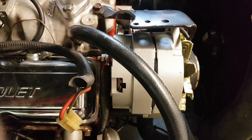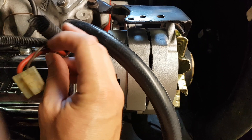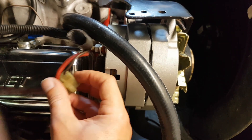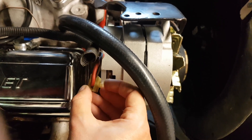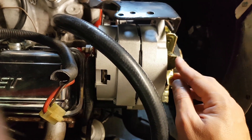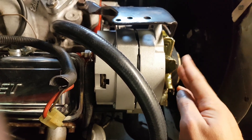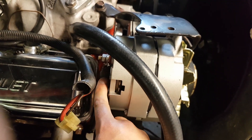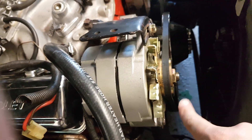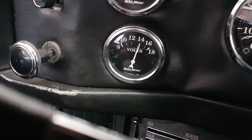There's our new-old voltage regulator. We'll put this in the car and see if it makes any difference. The alternator is back in — this is the PowerMaster one with the voltage regulator swapped over. I'm leaving the connector unplugged because it has the exciter wire and the voltage sensor on it. I think there could have been an issue with one of those that caused the original voltage regulator to blow. We don't need those just yet. Possibly it might start charging straight away or we might need to reach 1,000–1,500 RPM. All we have is the power connected at the back — ignore the coolant leak, I've just changed the line so that's just from when the line came out.